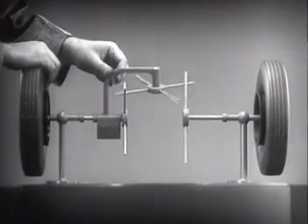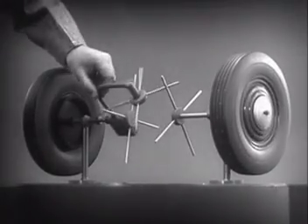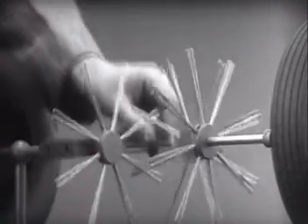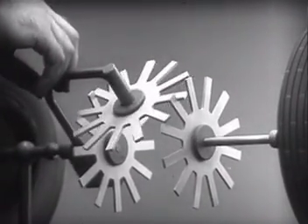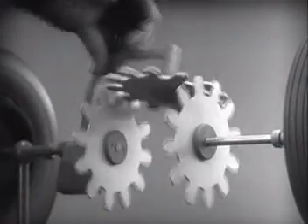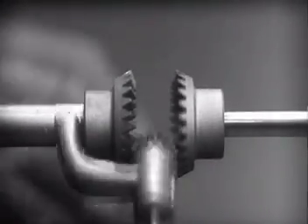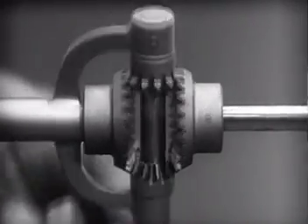To adapt the model for use in an automobile, we will have to make a few changes. In order to reduce the jerky action caused by wide spaces between the spokes, we will put in more spokes. Further filling in the spaces between the spokes gives steadier, more continuous action. Changing the shape gives firm, constant contact. Now we can make the gears thicker and stronger, and we have differential gears. The edges are cut so that they will fit together more smoothly and silently, and another gear is added to share the work of driving the axles. The principle is the same.